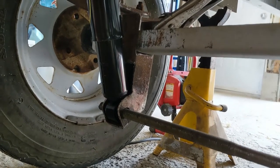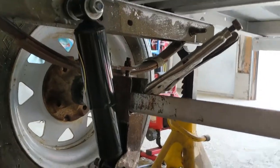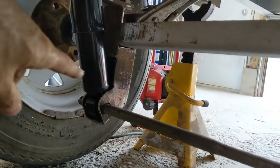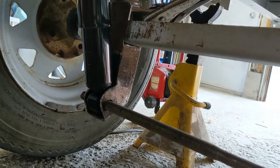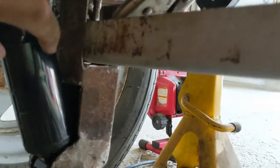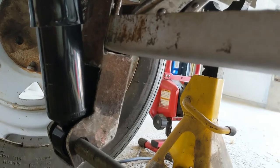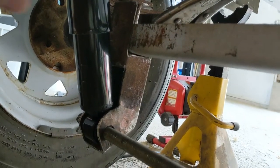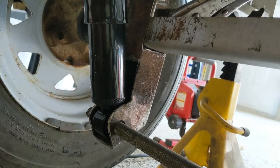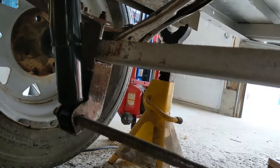The Ranchero is like a truck, so this should be okay — it's not an off-road rig. Now that I have this one fabricated, I'll use an actual five-eighths bolt with lock washers rather than threaded rod. She's got lots of clearance for movement — just enough. When I set it down the axle should come up a little bit and there's quite a bit of room to move. I can modify it if I have to, but I'll go with this for now.